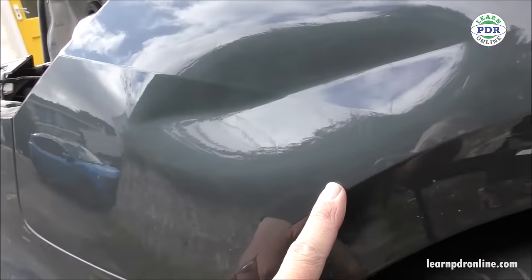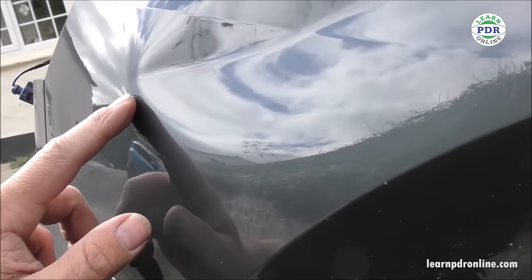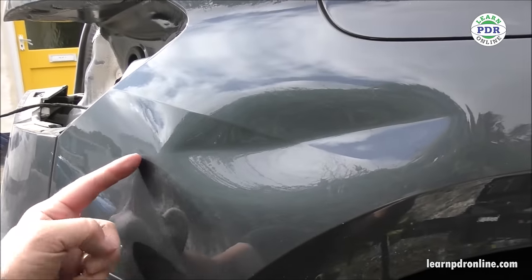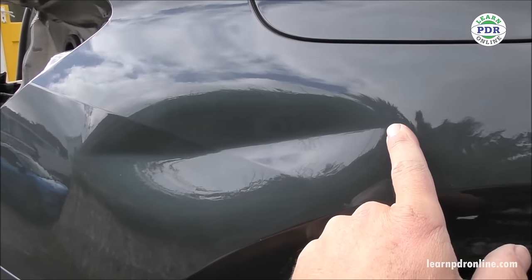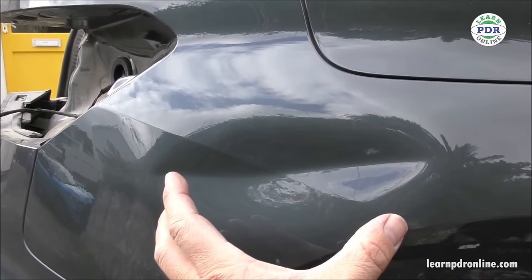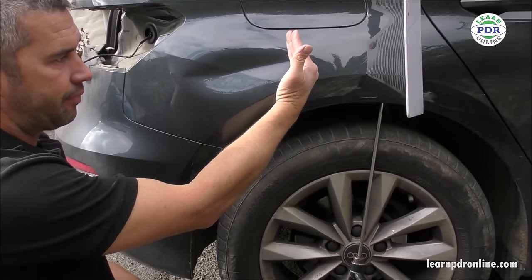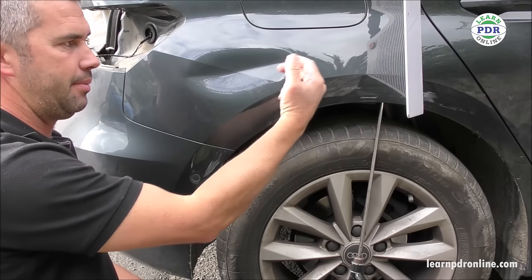Now there's a very slight crown here and a more pronounced one on the back end here. So I'm going to do a couple of light little taps here and here - that reduces some of the tension which will help me be able to pull some of the low. By putting pressure and tapping this way, I'm encouraging that tension in the panel to move that way. As I tap this side of the crown, applying pressure here and here, I'm persuading that metal to come inwards, which is going to help in that lifting process. Starting on the outer edge of the crown and tapping it inwards is what I mean by helping feed the tension towards the dent.